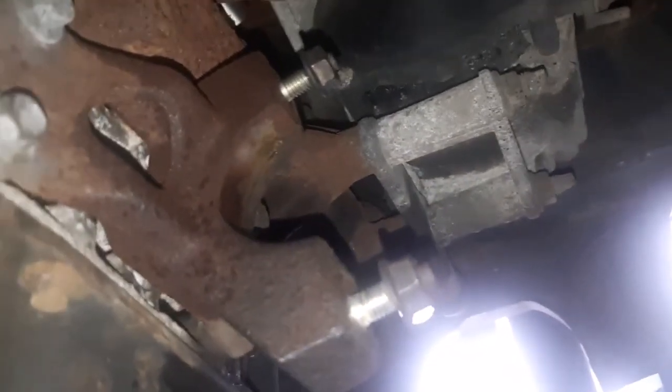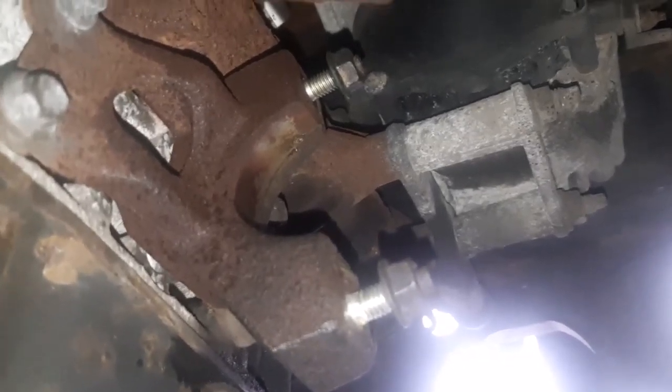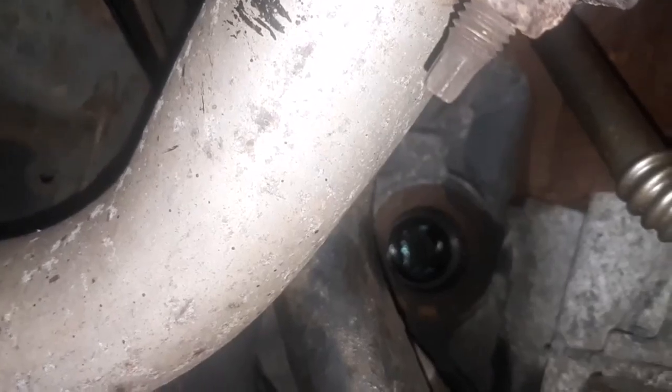And then once you've drained the gearbox, you can then remove the drive shaft out of the actual gearbox. So that there is the bearing hanger. I think they're 13mm or 1/2 inch nuts to take that off. So they were relatively easy to get off. They weren't tight. Well, they were tight but not seized. And then your drive shaft just pulls out of the gearbox. I don't know if you can see the drive shaft hole. There it is, I think. The drive shaft just pulls straight out. There wasn't much resistance with that at all once the hanger was off.